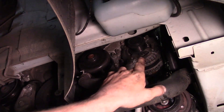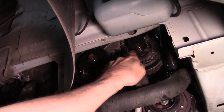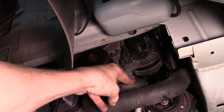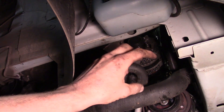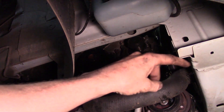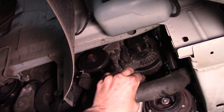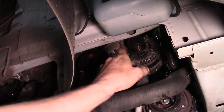We've got two near the top that we'll work on, and we've got some positive cable and the actual connector for the generator field from the PCM. So far it looks like we're not gonna have any issues, and we didn't have to mess with the cooling system, we didn't have to take the fan out. All we did was take the two bolts out of the lower AC compressor and then the two upper nuts and two upper studs, and we repositioned it. We already had to take the belt off, so we're gonna keep going with it. So far I feel good about it, and hopefully it's a good shortcut for people.